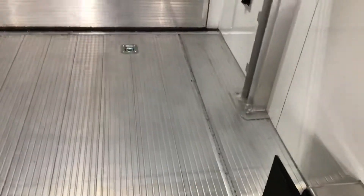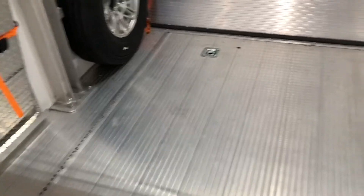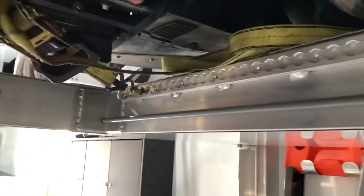I did airline tracks down here, running all the way front to back with multiple anchor points. I spread them as far apart as possible so that tires do not sit on top of them — because a lot of times you load the car hot after the last race and the slicks might still be hot and conform to whatever they're resting on. I also had the aluminum fabricators weld and stitch aluminum tracks in the center of the lift, because In-Tech only offered the airline track on top of the deck, and again I didn't want tires conforming to those either.